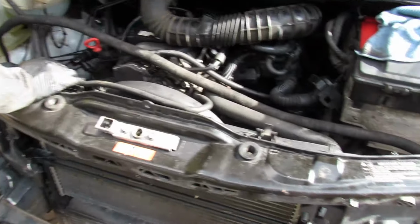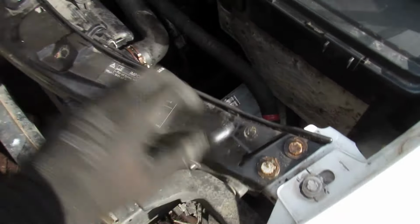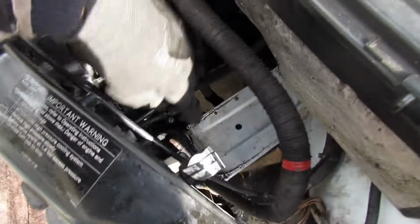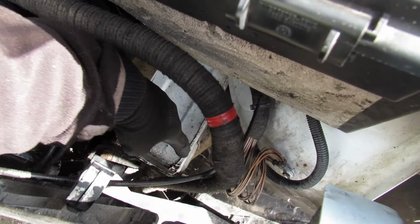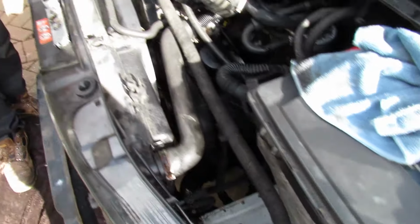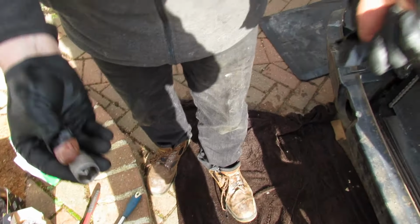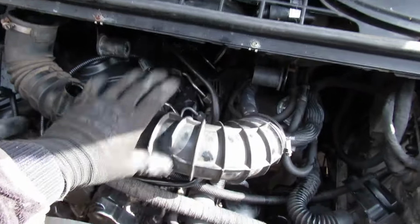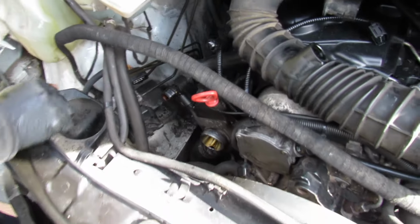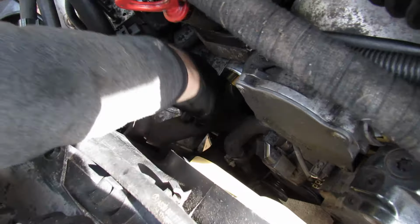Right, there's some pipes we need to remove. Because what we're going to do is take these bolts off here, this metal brace that comes across, and the crush cans at the front, there's one here, and three bolts down the side. That's the same each side, but opposite. I'd say one is 10mm on there, and the others are 16. Yeah, they start going up in size. So we're taking this intake hose off, just off the bottom there with a Jubilee clip, and John's going to look at taking some of these radiator hoses off, so we can pull this forward.